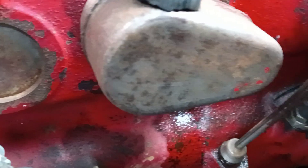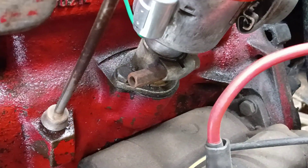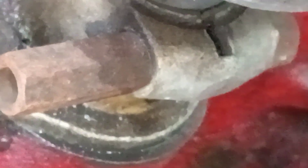Only after that, loosen the distributor mounting nut. On our engine the hold-down nut for the distributor is difficult to reach and turn with a wrench. A custom nut like this can be used — you see it is longer than the original nut. This longer nut is more convenient for adjusting the ignition.